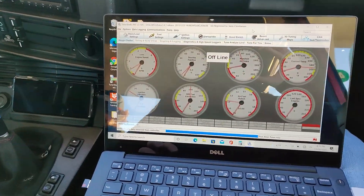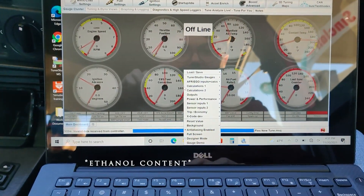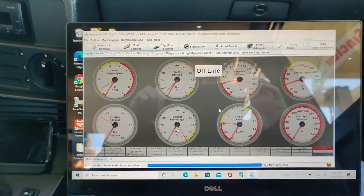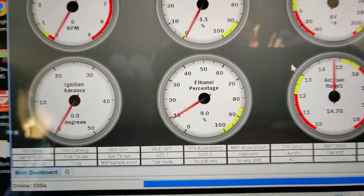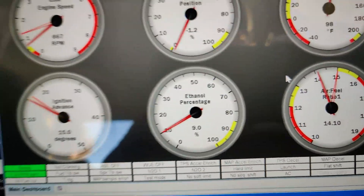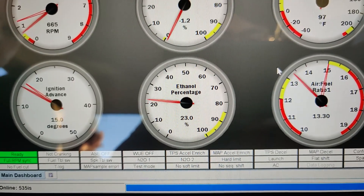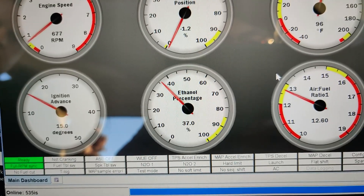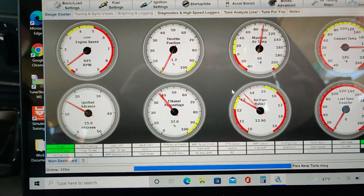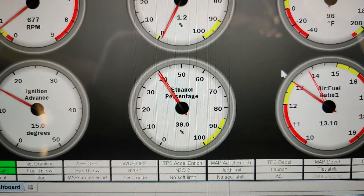We just put in a little over half a tank of E85. Now we're going to fire it up and see what our E85 percentage is. Go to Sensor Inputs > Ethanol Percentage. Fire it up and watch this percentage come up — it will take a minute just to come through. You'll watch it go from 10% and then it gets a whiff of the good stuff coming through the line and jumps up — 15, 17, there we go — so it'll be in the 30s somewhere. Around 30, almost 40%. It will probably still keep mixing — 38%, 39%... it'll probably rest around 40%. The tank just needs to mix in pretty well.